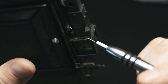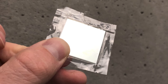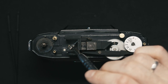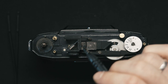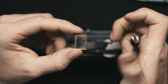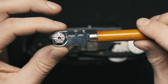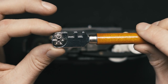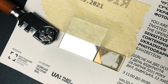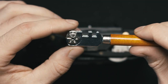I'd like to give you a few pieces of advice. When I got this mirror piece from China it was three by three centimeters, so I needed to cut it to fit — the mirror in this model is about 21 by 11 millimeters. I used the old mirror as a reference to cut the piece to the same dimensions. My recommendation is to use a glass cutter to cut the mirror, not anything else, because the cut will be clean, the edges will be clean, and you will have no pieces of glass flying around. In general, a glass cutter is the proper tool to cut glass.